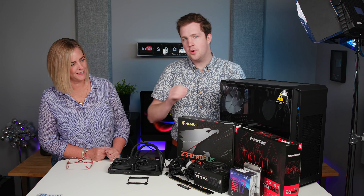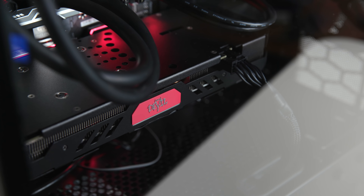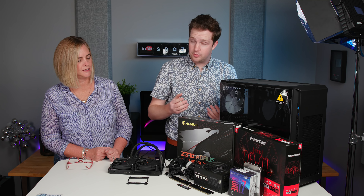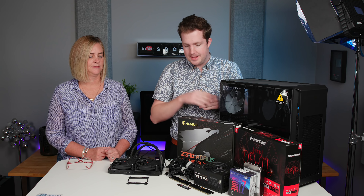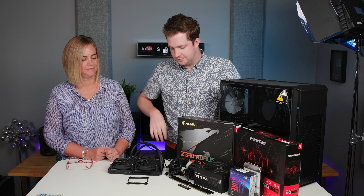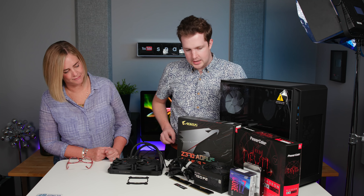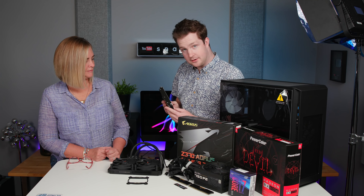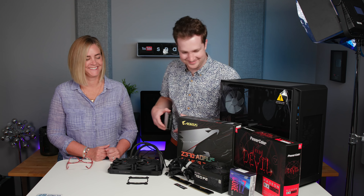In the GPU department, we decided to go a little more chill — a Radeon RX 570. Because we won't be gaming, we don't really need that beefy of a GPU. Some apps like Final Cut Pro can use hardware acceleration, and these GPUs are natively supported in macOS High Sierra and the new Mojave — so no drivers, just plug and play. We've also got a Samsung NVMe 950 Pro M.2 SSD for the operating system, an 8TB spinning SATA hard drive for long-term storage and photos, and your big iTunes library. No one uses iTunes.